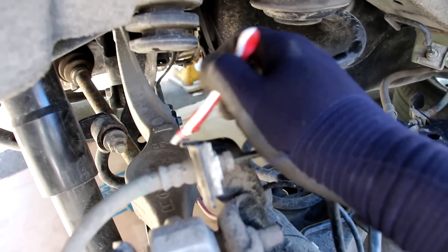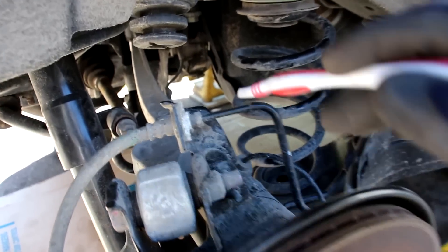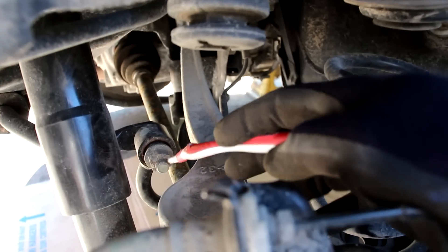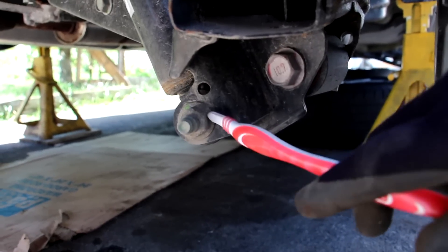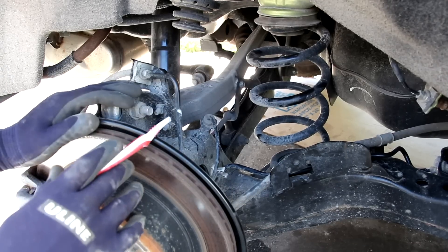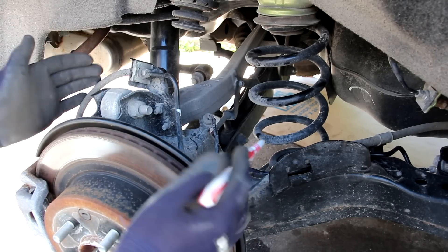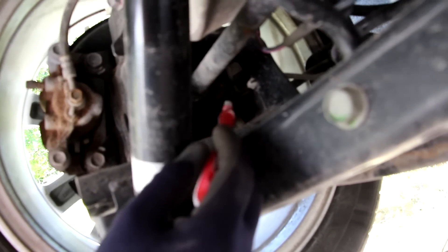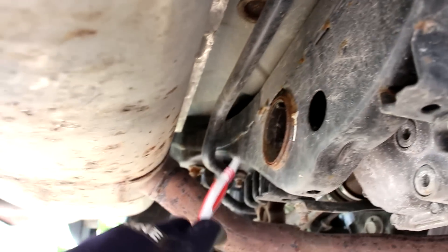The flat spot on the trailing arm is for the bump stop. The upper arm is the only one made of aluminum — the rest are steel, suggesting it may be shared across another platform. The stabilizer bar link is a unique S-shape because it has to curve around the drive shaft to plug into the lower control arm. Replacing the shock is pretty easy at the bottom with just one bolt, though the top bolt is difficult to access. Overall, the Qashqai at this price point does give you an independent rear suspension which should lend to better handling, though working on it will be a little difficult. The rear bearing is a bolt-on style, so no press needed.